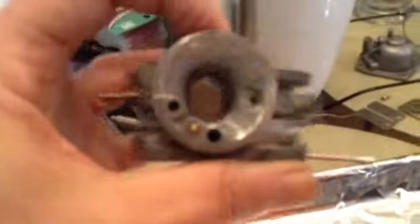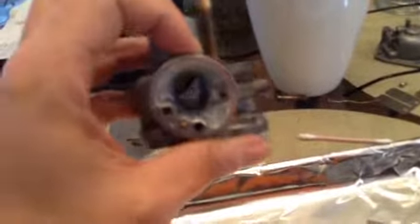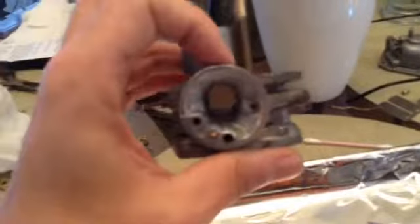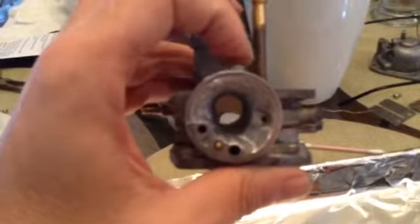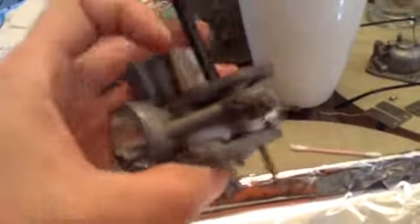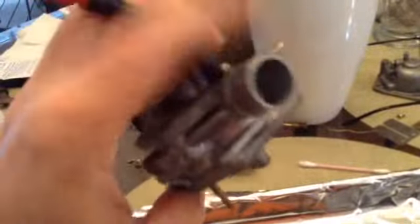You know, including all sides on this, probably 2 millimeters, like half. But I think I said that already. Anyway, I'm not sure which is the biggest blockage for my Polaris 2004 two-stroke. So I started to sand this up and make it smooth, but there's a Venturi effect, and it's only 16 millimeters in the middle of this carburetor. It's a 19 millimeter, but it's a Sun World or something. It came off my Polaris 2004 that I got for the kids for Christmas recently.